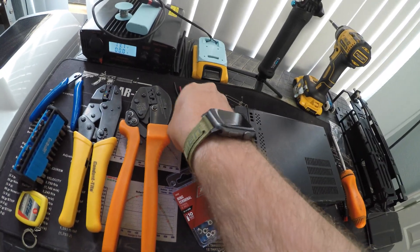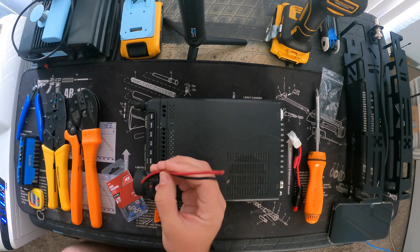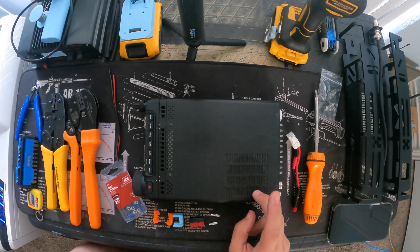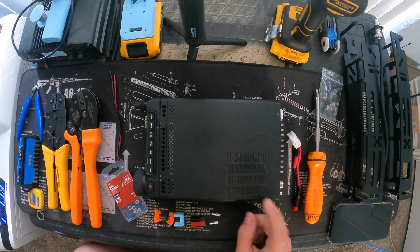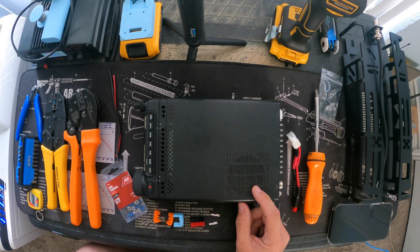You're also going to need two pieces of wire. I ended up grabbing some 14 gauge red and black wire - should be plenty thick enough. If you look at the wires already in there, they're not that heavy of a gauge, and it's quite a short run, so realistically having super thick wire isn't going to help much.